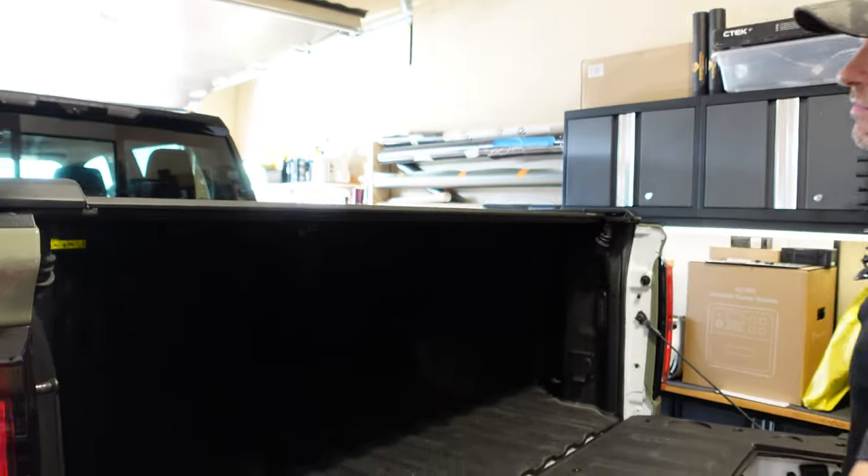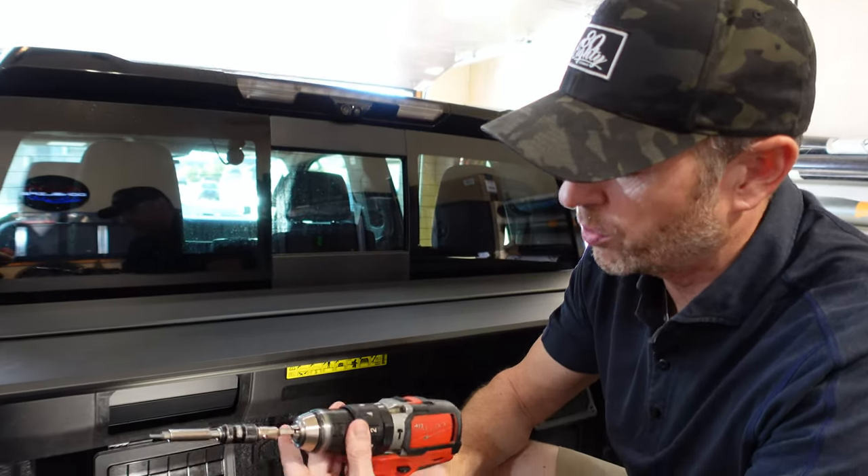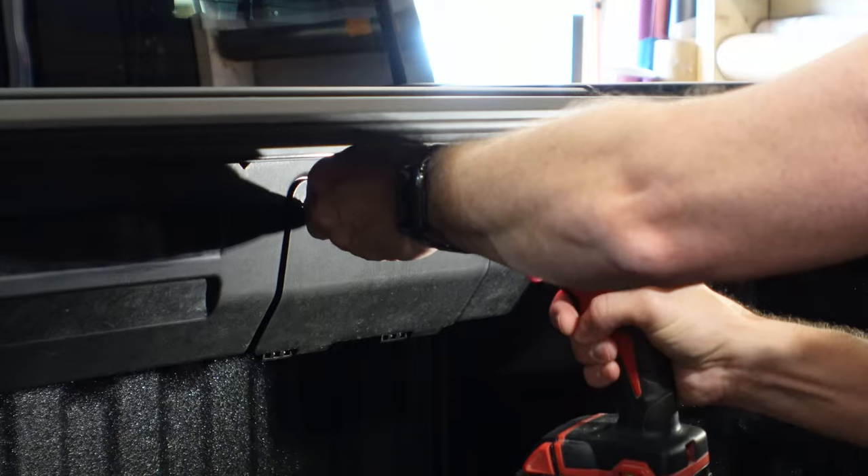Using some plastic-compatible silicone spray, we need to lubricate the spirals at each end of the canister, because this is what the roll track rolls up into. Now we'll open it up and reinstall our inspection covers. Make sure you don't over-torque the bolts, so put the driver on a nice low setting. And that's really it for the maintenance. Once it's done, you should run a calibration cycle to make sure everything's calibrated properly. We're going to do that at the end after I swap out the ECU.